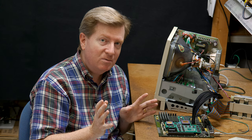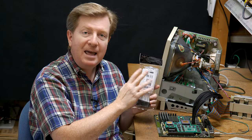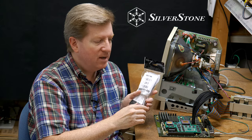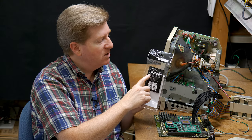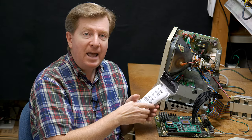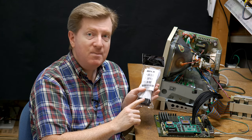The best overall solution — the idea did not originate with me, I actually read it on a forum quite a while back — is you need an ATX power supply cable. This is just one example: the Silverstone brand. I have a black one here; the packaging says PP07-MB, with the last letter being B for black or W for white. You will need a 24-pin ATX power supply cable with one end male and one end female. And that's all you really need.